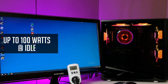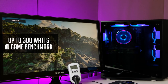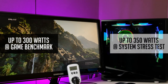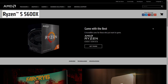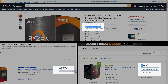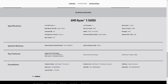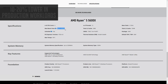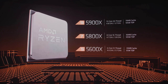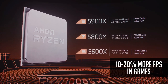This is definitely a good video editing PC for its price. And as you can see, it provides some nice numbers in 1440p gaming, not even mentioning 1080p performance. The Ryzen 5 5600X CPU can also be an option, in case you can spot one in stock. Even with 6 cores, its performance in production workloads is really impressive, but is around 10–20% lower than the 3700X. At the same time, the 5600X has a 10–20% performance increase in gaming.